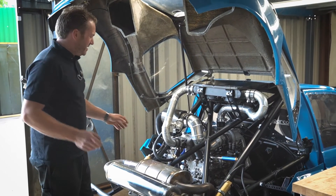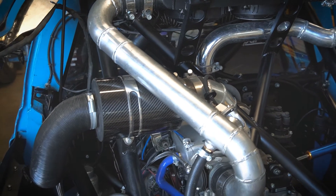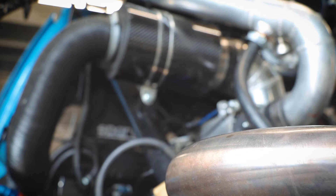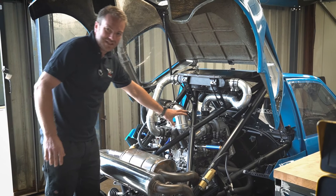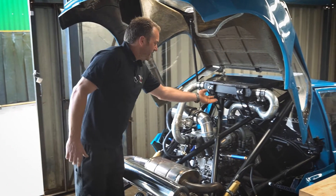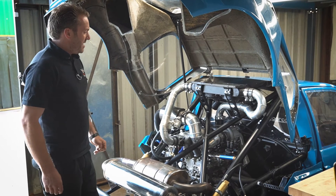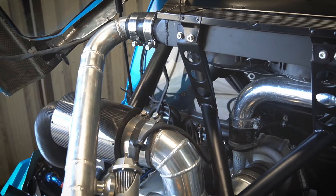Let's start off with the engine. One of the first things we've done is we've re-routed the cold air intake to the supercharger, so that it's actually getting cold air from the wing here, and it's getting filtered through this carbon fiber air filter box. Originally it was just taking hot air in from the engine bay, which wasn't going to be any good for charge temperatures. We've also added two fans to the bottom of the charge cooler, so you can turn them on inside the cab to suck cold air through, which helps reduce charge temperatures, meaning we can put more boost in.